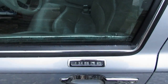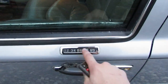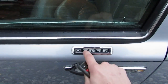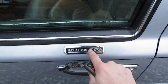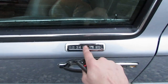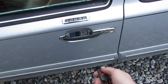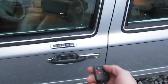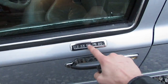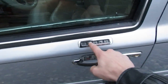The best method when I programmed it: enter your code 6-0-7-5-9, then press 1 and 2, then 3 and 4, then 1 and 2, then 3 and 4, then enter your code again — 3-4, 6-0-7-5-9. Your lock cycled. When your lock cycles like that, that lets you know you have officially programmed your new keyless entry. Enter 6-0-7-5-9 and it'll store the code.